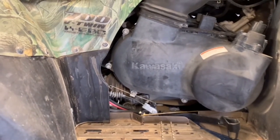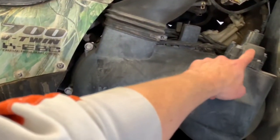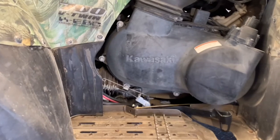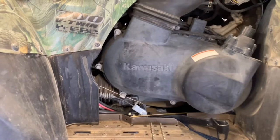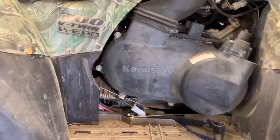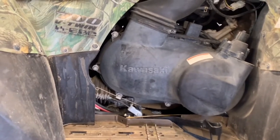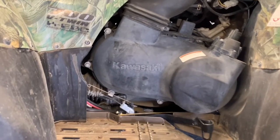This is a common problem on these four-wheelers. These actuators will also periodically need to be reset, and you can find a lot of those instructions online — I think I have a couple of those videos on my channel. It's something you've got to reset periodically, especially when you service your four-wheeler or if that belt trips the solenoid or actuator — it's going to need to be reset.